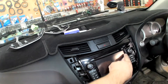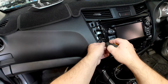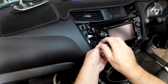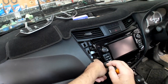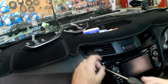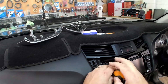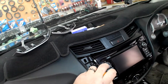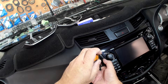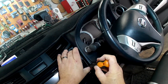Because this is a full radio, I also have to remove the four silver screws that are hidden right down there. They're a little bit easier to get to without the fascia in the way, but it's not impossible. It's the joys of a magnetic screwdriver — when it works, that's great.